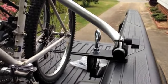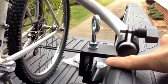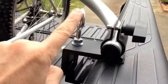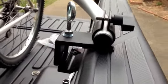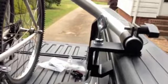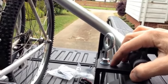I want to recap. On my 2011 Tacoma, here are the modifications I made to make this thing work. Modification one: metal cut-off to cut off the lip on this part of the clamp, so it will give me more surface area in contact with the actual truck bed rail. Modification number two: the eye bolt that came with this thing is just too short, so I bought a longer eye bolt from the hardware for a couple of bucks. That made a better connection. Modification number three: this thing straight from the factory comes with an eye bolt and two nuts — I don't have a lot of faith in that system. So on my longer eye bolt I used one nut, with a washer against the clamp for better surface contact, a lock washer in between, and on the underside a nylon locking nut, so the inside is coated with nylon and it's absolutely not going to come unscrewed.